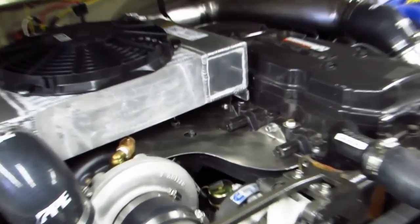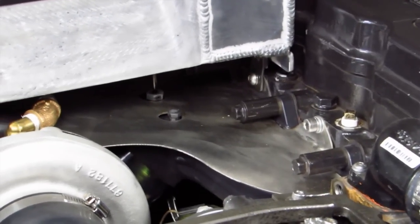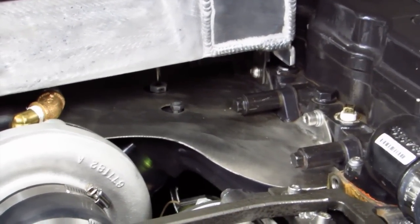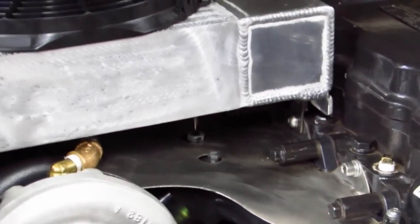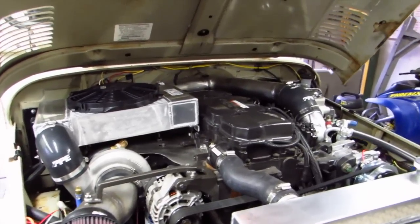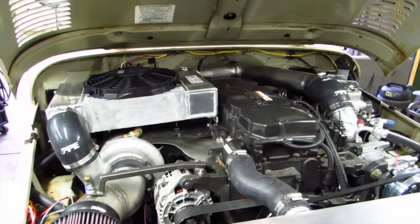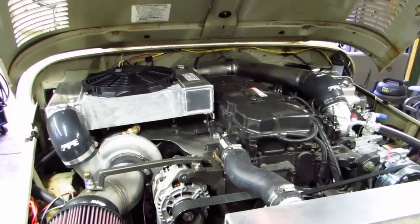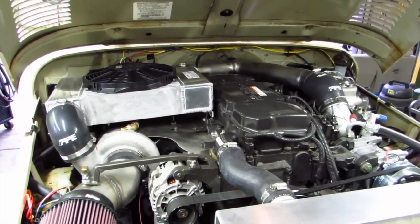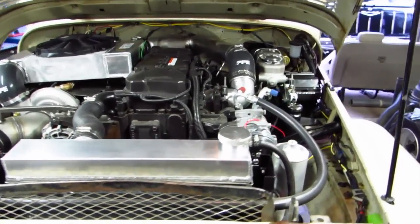I built a little stainless steel heat shroud to cover up the custom CNC machined exhaust manifold built at a Steed Speed shop up in Canada. From past trials, they run roughly about 100 degrees lower through the EGTs over the band than a stock manifold would. A lot better flow characteristics. And this thing does run super cool.